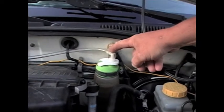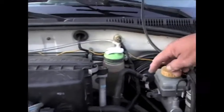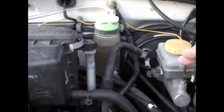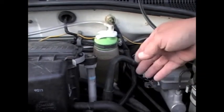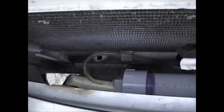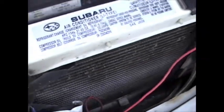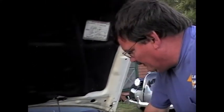The reservoir with the water is up here and it's got three lines on it: one on the top where the gas comes out and goes into the throttle body, the middle one is where the gas comes out and bubbles up through the water — it's called a bubbler — and then the feed is on the very bottom, which gravity feeds it down into one end and the gas pumps out the other end.